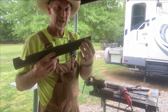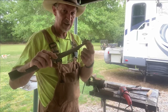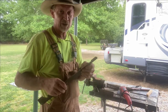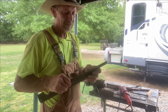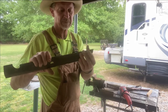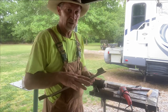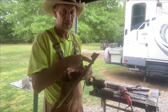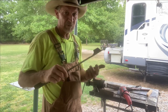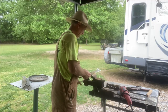Another thing: when you're sharpening the blade, you don't want it sharp like a pocket knife — real fine on the edge. You don't want it sharp like a knife because any little thing it touches will nick that blade when it's that sharp. When you're sharpening a mower blade or a bush hog blade, you're just getting the bevel back on it and straightening it out. Also, go slow and don't put too much pressure on it because you'll start overheating the metal. If it overheats and gets discolored, that softens the metal and then when you mow it won't take much to nick that blade.